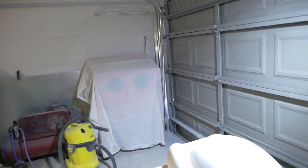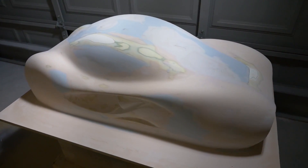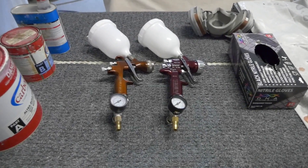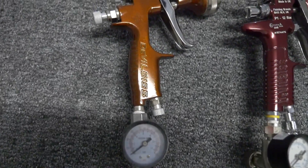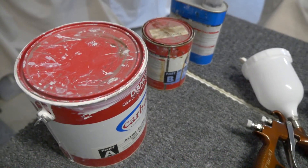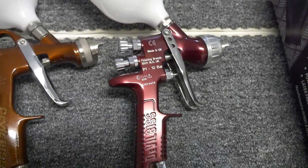It's now in the final stages of shaping again. What I'm about to do here is paint it with a thick surfacer, which is going to fill in all of the little tiny pit marks and give me a nice surface which I can continue to remove all of the ripples and bumps from, as you can see here. I have here my beautiful Devilbiss spray guns, and the one I'm going to be using today is this one — it's a primer gun with a 2mm HVLP nozzle. The reason I need the 2mm nozzle is because what I'm spraying is basically a surfacer — it's very thick, it's actually 2-pack. So I can't use this other gun, which is for top coat and clear coat and has a 1.3mm nozzle.